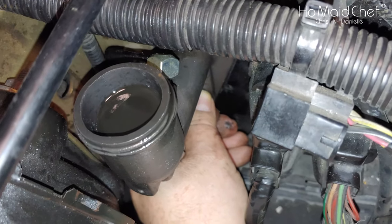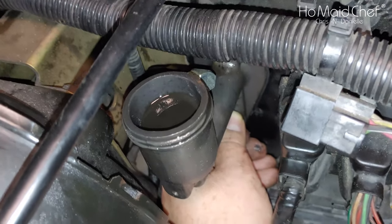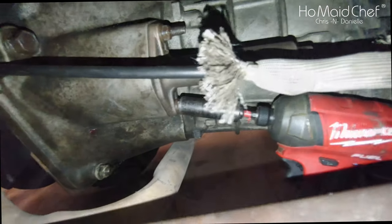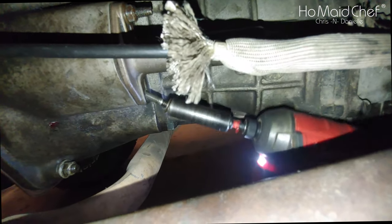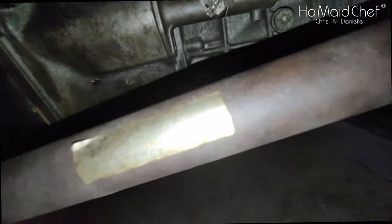Okay, so we're not getting air out of that, so I'm probably going to have to take it fully loose because we have air in the pipe, and we're going to have to take the bottom out to work the air out of the system, because there is no bleeder valve. Okay, so to take off the slave cylinder, we're going to back off these few bolts right here. There's one here and there's one at the top.